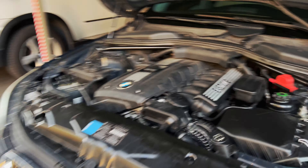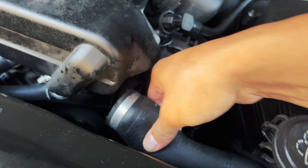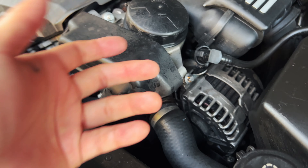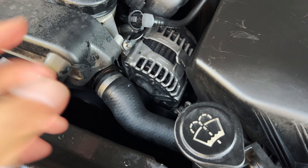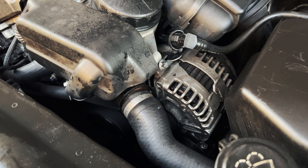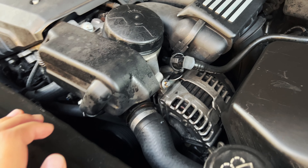The familiar sight of liquid underneath a car — my car's coolant upper radiator hose exploded. As you can see, the whole thing came off. Luckily it's just the hose. I thought the thermostat lived up here and was also broken, because this plastic bit is brittle and broken off, but I realized it's just the hose — it's a hose with a plastic end connector. I was in the In-N-Out drive-through, totally fine, then right when I got the burger and got out of the line I saw a bunch of steam, so I had to pull over and get the car towed all the way home.